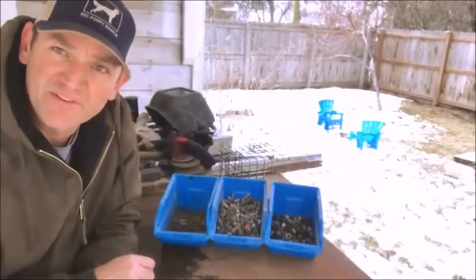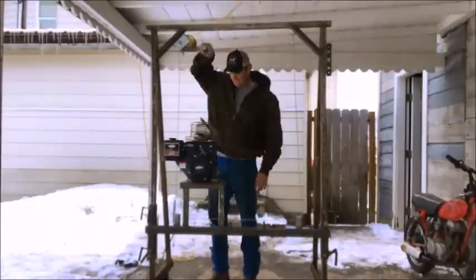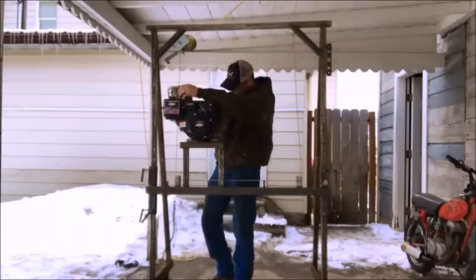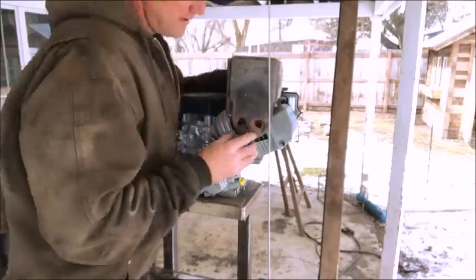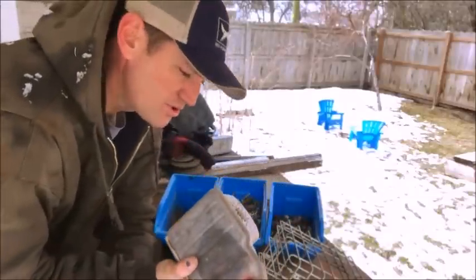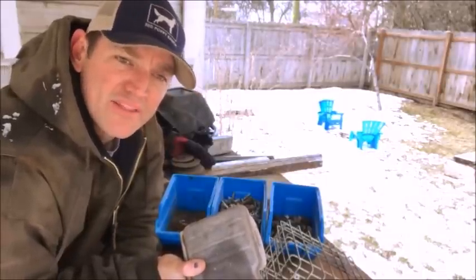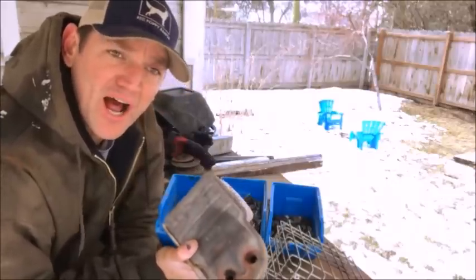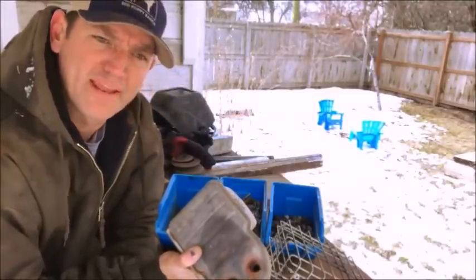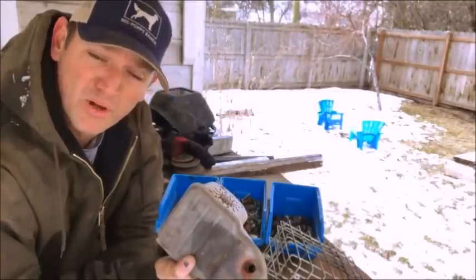She's alive. I'm trying to get some of the trivial stuff figured out before I get back into fab work. One of the trivial things was the muffler — it was too big and it's rubbing up against the pulley cable as I raise and lower the power head on the sawmill. This is going to get pretty hot and I don't want that cable rubbing against it — it's just a premature failure point.